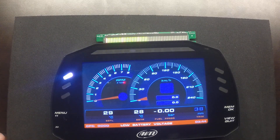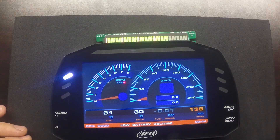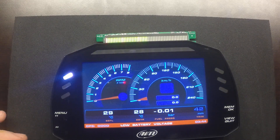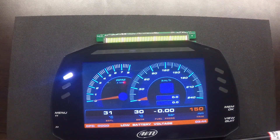As the trim potentiometer moves up and down with engine trim, you can see the live reading in millimeters, and that's freely configurable to be whatever color combination you want as the engine moves through its full range of trim. This indicator can also be remote mounted somewhere on the dash to allow for more flexibility in how you're visualizing that critical piece of data.